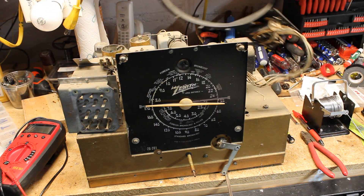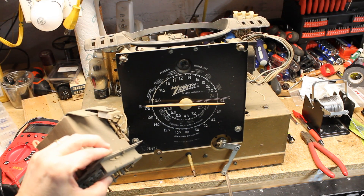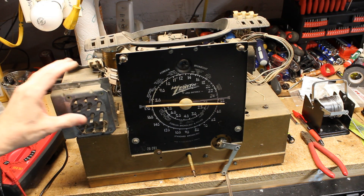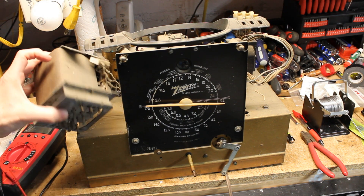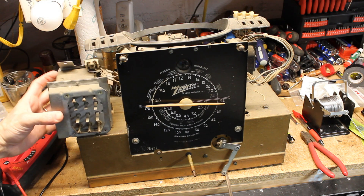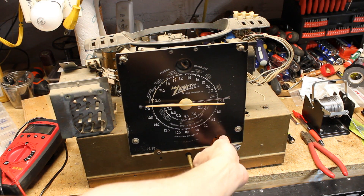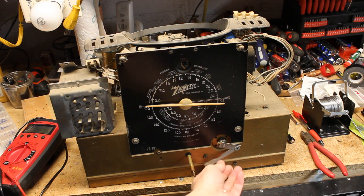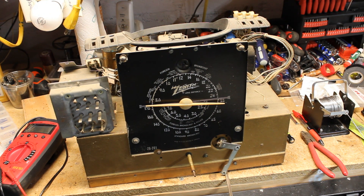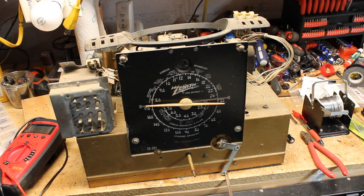I have taken the glass out and put it away safely. Here are the preset tuner controls, and the organ controls over here on this side for the tone controls — they call them the organ controls on these Zenith radios. The band switch selector is right here; it hooks to a different type of knob on the shaft around the shaft. The tuning selector shaft has been removed.